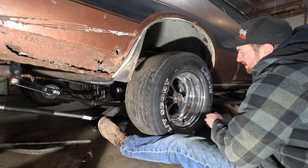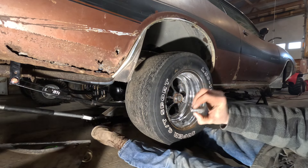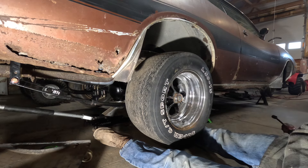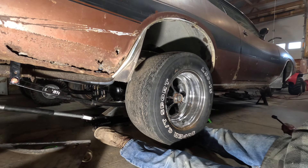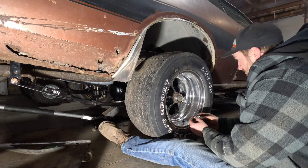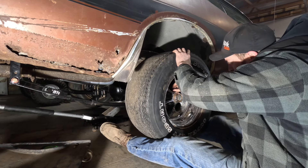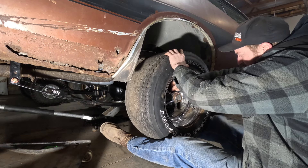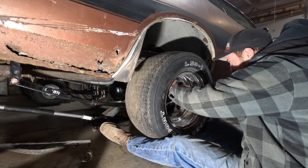These rims are unilug. They use a shank-style lug nut — that's the face, and that shank centers the unilug slot for the bolt pattern. Then you've got to run these washers. These ones are really worn out; I'm just using these old ones, putting two on just to hold these on, but I have a new set as well. They're good for five on four and a half, and then up to five on four and three quarter for GM cars — kind of like back in the day, one wheel fits all. They're kind of tricky to put on: you put the wheel up, find one that's kind of centered, get one started, then get them all kind of started and slowly snug them up. Sometimes it can be a big pain to keep the washer in place.